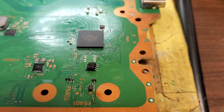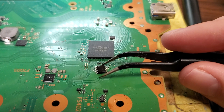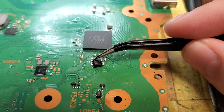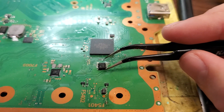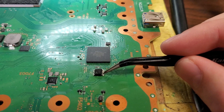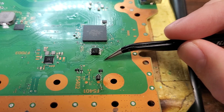First thing we want to do is come over here — this is the BIOS chip, and normally it'll be sitting on here. Pin number one is this pin right here, noticed by a little divot on the top of the chip. I have some flux on there so it's kind of hard to see, but there's a little divot and that's how you know it's pin number one. This is also the Southbridge chip here, so when you take this off you're going to use some flux and a hot air gun. As you can see I knocked a component off there, but that's perfectly fine.